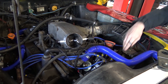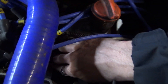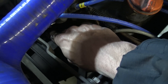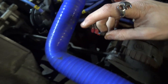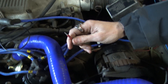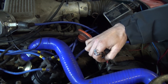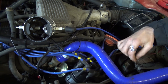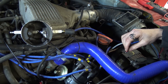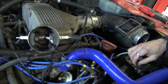The next thing we need to do is find the two wires that plug into the side of the distributor to trigger our amplifier — the blue and red ones. We can forget the blue one; we're just going to trigger the amplifier and coil with the red one. We're going to tap this on and off an earth post — we have to tap it on and off; it's no good just holding it on, we will not generate a spark. With ignition on, every time we tap this on and off, we will generate a spark.